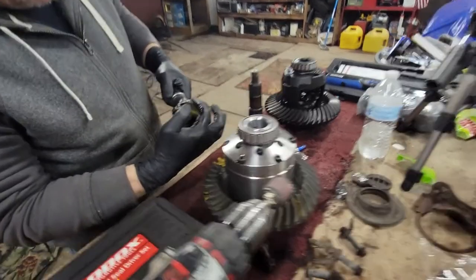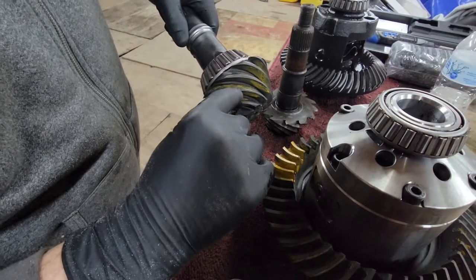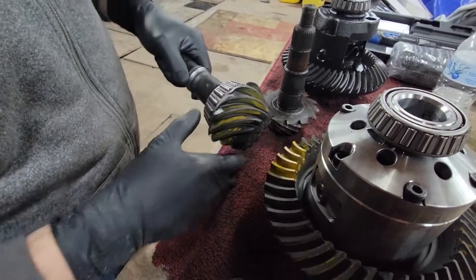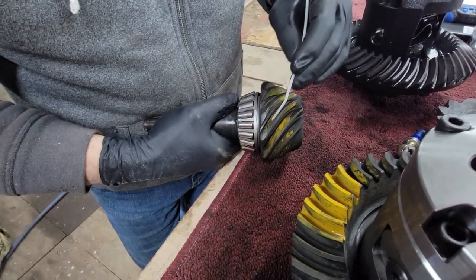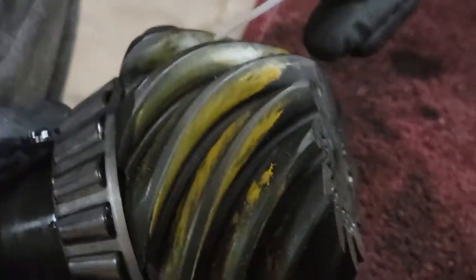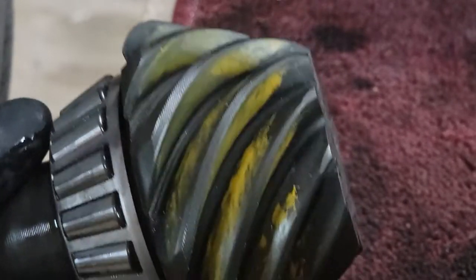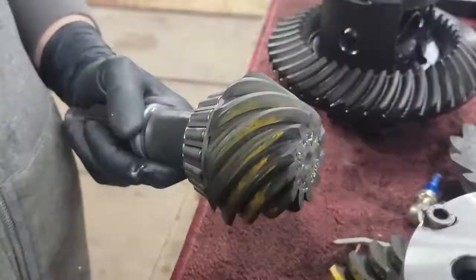See how they fit in there and they're touching the gear — touching the teeth all the way from one end to the other. They go right to the edge, from the top all the way to the bottom; they don't go to the very inner portion of the gear. What we're talking about is that on both sides of the teeth, the gear lays in just nicely. The yellow paint mark goes from the bottom of the tooth to the top of the tooth — it's not all the way down in there, which means it's not too close to the pinion gear and not too far away. You can see there's a mark here and a mark here, and that means it is right where it belongs.